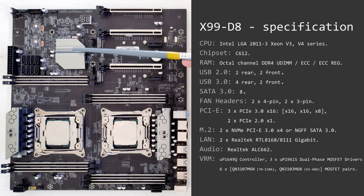The chipset is located under this heatsink and it is the Intel C612 chipset. Next to the chipset heatsink you will find the BIOS chip located right over here. The location is not the best because you need to remove this heatsink to be able to connect the CH341 external clip to re-flash the BIOS.